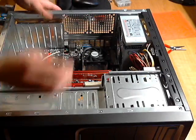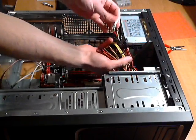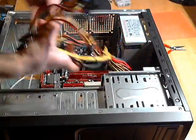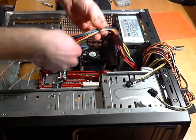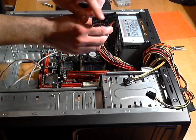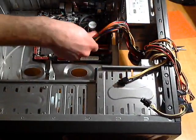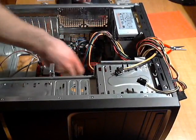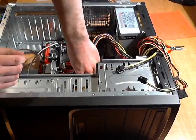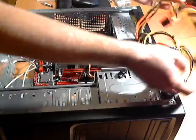Now go ahead and figure out the cables. I'll do the power cables first, then the data cables — in my case they're all SATA cords, so that makes it easy. Go through and untangle them all. This long one is for the motherboard — you can tell because it's really long, and the connector count matches the white port on the motherboard. It just plugs in and clips into place. This applies to every power supply out there.